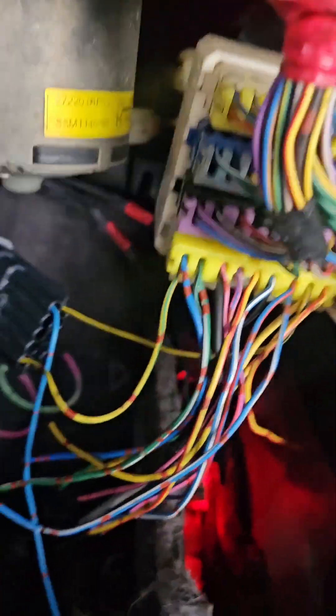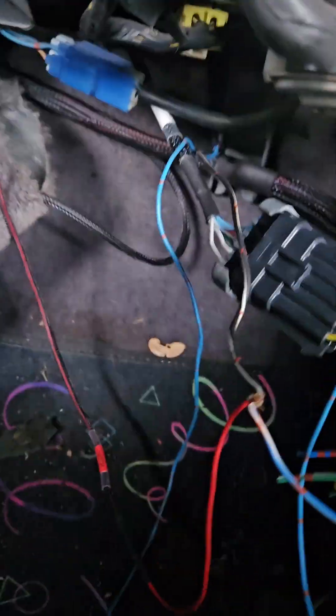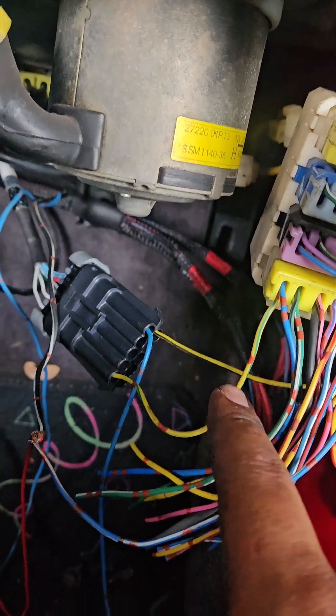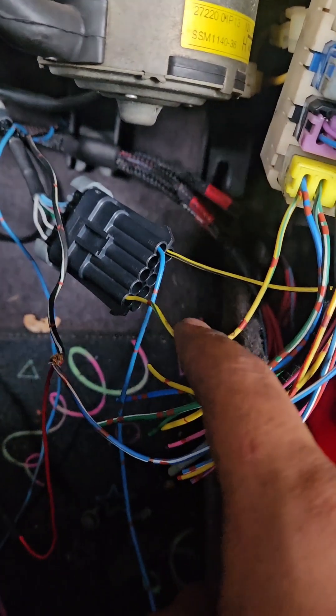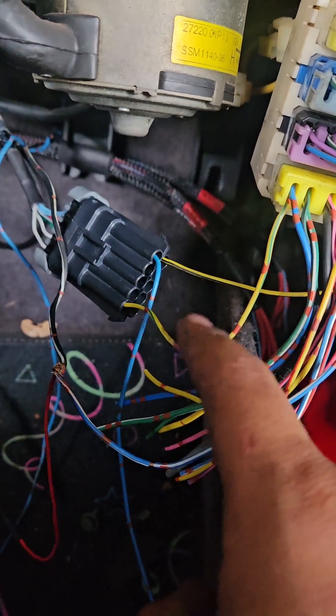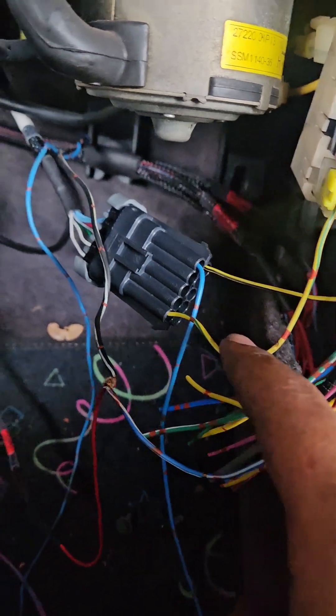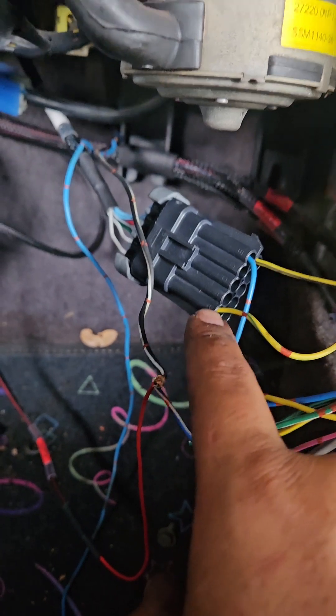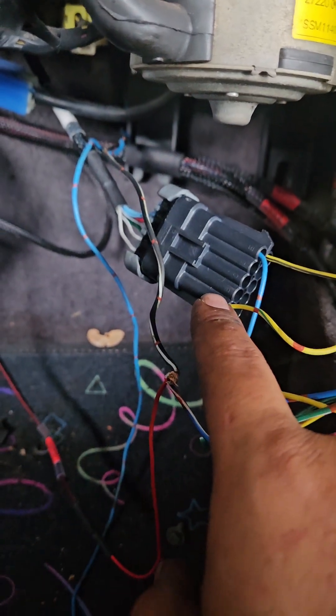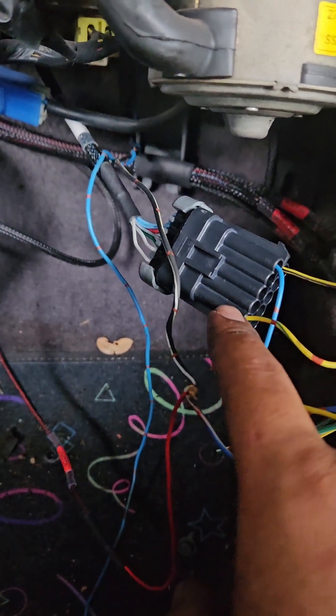On the Z31 I've got some more wiring figured out. This right here is actually the yellow-green wire, and when you activate the AC compressor it sends 12 volts here. This wire actually used to go to the ECU — it still goes to the ECU, it's just the FuelTech now, and on the software you have to set this up to a positive input.